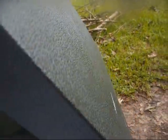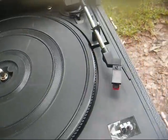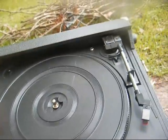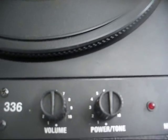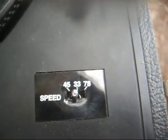This is Radio TV Phono Nut, and what we have here is the Crosley of classroom record players. This is an MPC Systems Classroom Record Player that I've already opened up. I believe this is from 96 or maybe early 97, based on date codes. As you can see, it uses the same basic turntable mechanism as some of the Crosley models, with a little red needle and ceramic cartridge. We have controls for volume, power, and tone, a headphone jack, play and pause, and a three-position switch for 45, 33, and 78.